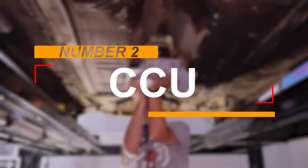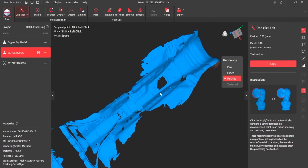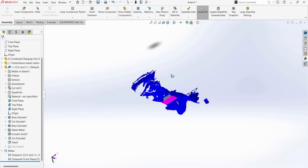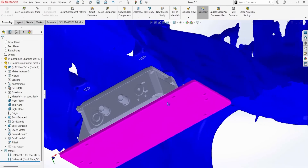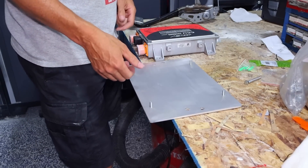Now that we've got the charge port installed, the next part is the charger itself. We got a combined charging unit which combines DC to DC converting as well as the onboard charging. The first step was scanning. After we got a good scan, we put it into CAD, modeled the bracket that would hold the CCU or combined charging unit, and ordered it from SendCutSend. Next we have this plate — this is to mount the combined charging unit.